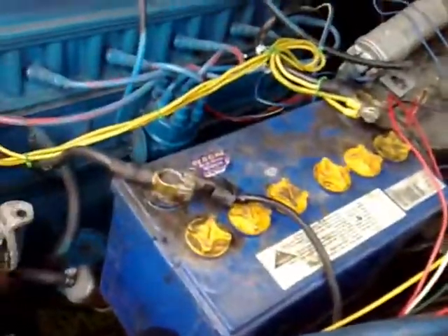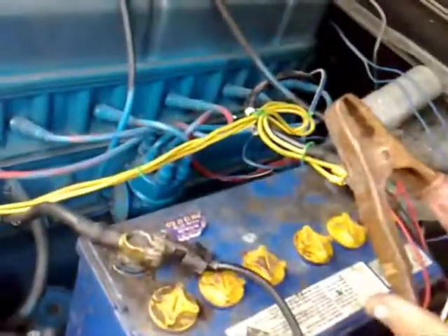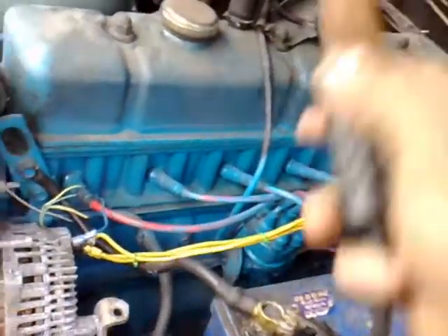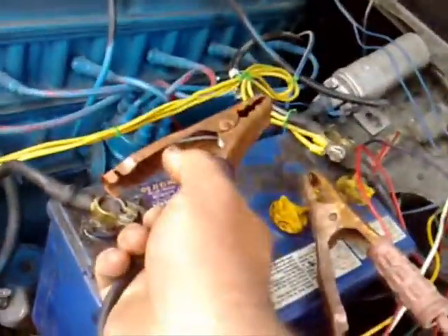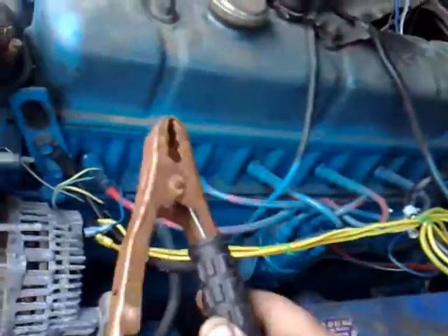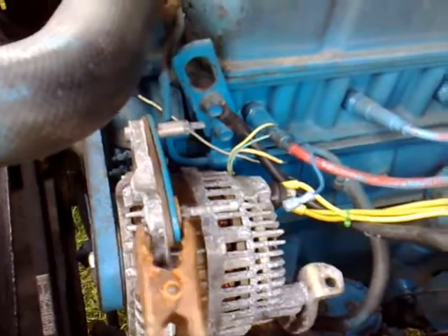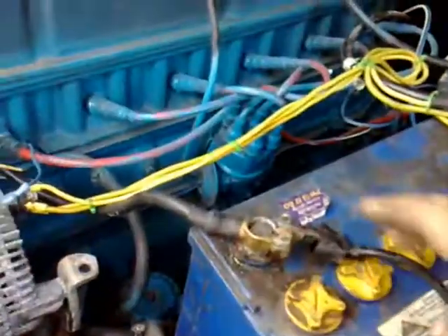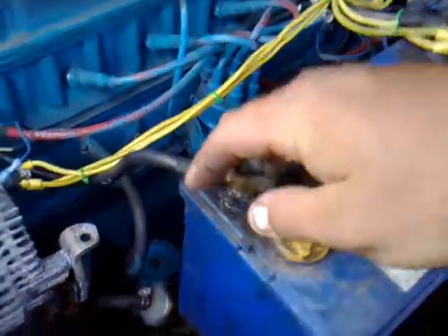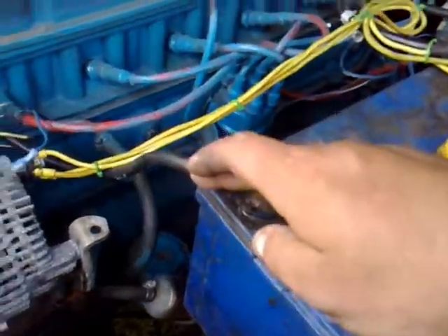You don't want to get them mixed up because you will break things. I always start with my negative terminal. I know some people say to start with the positive, and I think you're actually supposed to, but the main reason I always start with the negative is because I want to find a nice solid earth point somewhere on the engine. I don't want to hook it up to the battery because the power from the jumper lead will get split — some going into the battery, some going into the lead.